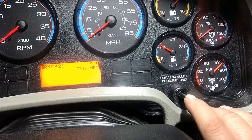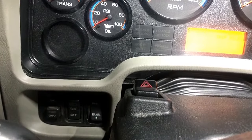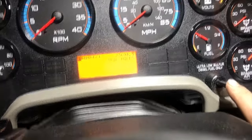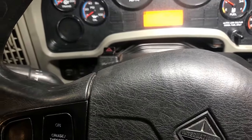You're going to hold the panel light switch up and the selector button on the right at the same time, both simultaneously, and hold them for five seconds. That will clear out the alarm. I'll show you exactly how it works right now.